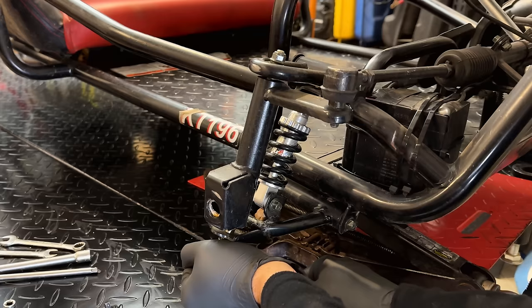The only other thing here worth considering is the start solenoid, which is this wire right here. So that wire needs to also be extended to the front. To that end, most of the front has been wired. I pulled out the original wire that was feeding this switch right here. It was a very thin gauge wire and only had two wires in it. I actually need three. So I pulled a heavier cord through with 16 gauge wire, and it also has three wires. So that's going to allow us to get this thing completely wired up.